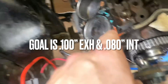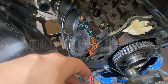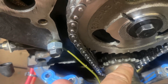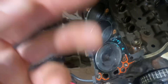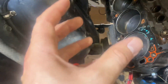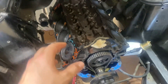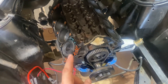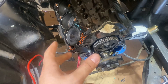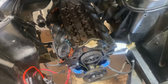You want around 80 thousandths on the intake and about 100 thousandths on the exhaust. We retarded the cam, put it on the different sprocket, and made sure to line up the dot and the new dot. We'll put the clay back on and roll it back over. In theory, this should give us more clearance on the intake side, and it should also tip the power curve towards the higher RPM range. Since this is a stick shift car with a single plane intake, if this works it's actually a win-win — our best shot at making the power we want.